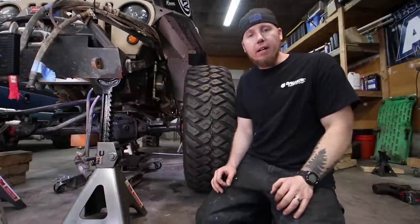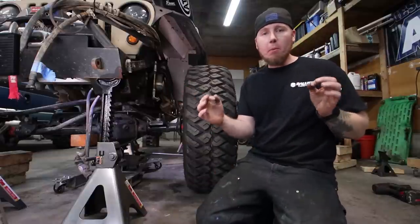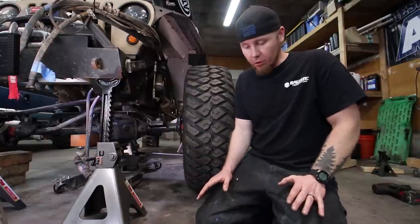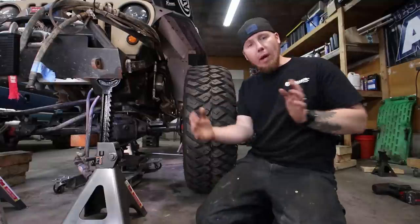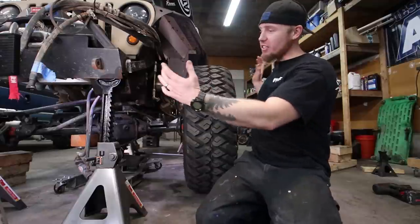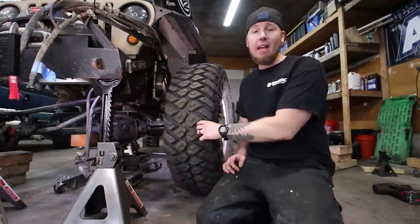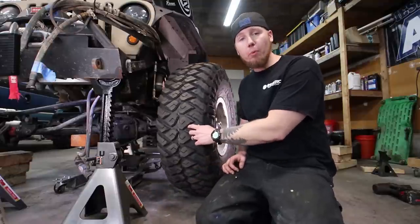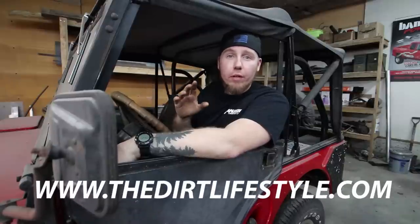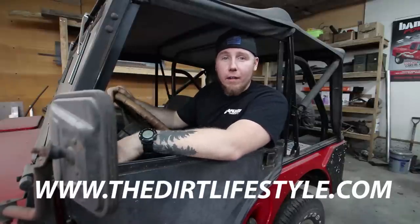The best way to combat scrub radius is — if you have wide axles, keep them as wide as you can. Narrowing axles is cool for the right application, but I'm running a full-width F-150 axle on a pretty narrow TJ. I knew I could use the right rims to tuck the tires in so it doesn't stick out too bad, while getting a really big advantage from a super small scrub radius. If you liked the video, subscribe to our channel, hit the thumbs up, follow me at Dirt Lifestyle Nate on social media, and check out thedirtlifestyle.com for t-shirts, hats, and new swag.